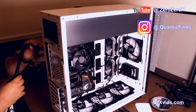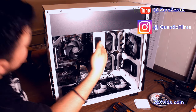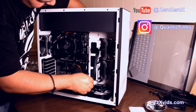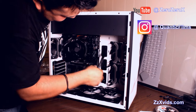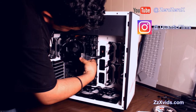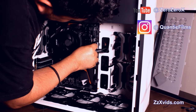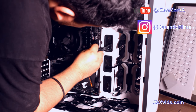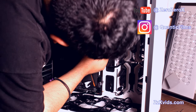Once we install the CPU fan and CPU fan connector, we need to find the semi-modular cables on the motherboard and find that 12 volt connection to install such a cable. And we put it through these rubber doors on the fan, so they're out of the way. The cable management is snug and nice in there. It goes on the side of the motherboard. That's one power connection. We have another power connection on top of the CPU, in the upper left corner, where the other smaller power cable connector goes.